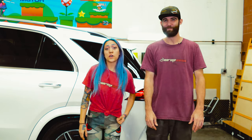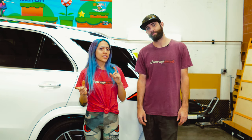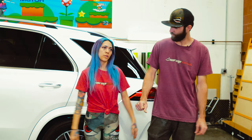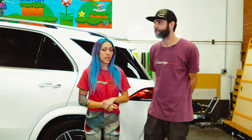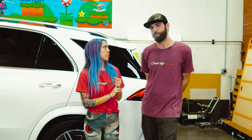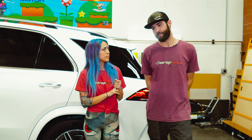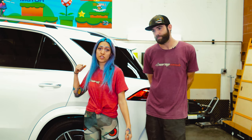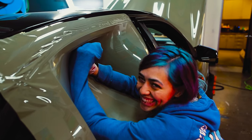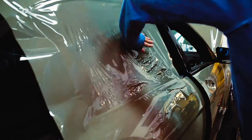So those are our best tips and tricks from doing this Mercedes wrap. For pros and cons: what I liked about it — it does look very glossy, very much like paint. It is considerably glossier than most vinyls. The colors are really nice. It had good memory too — if you heat and stretch the film super hard and then heat it again, the film bounces back with very little discoloration or surface imperfection.